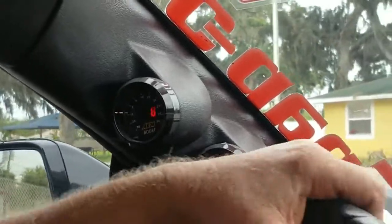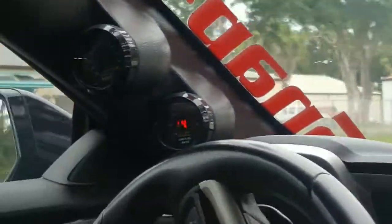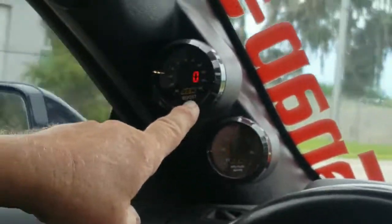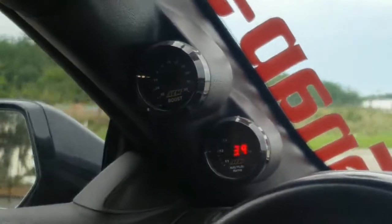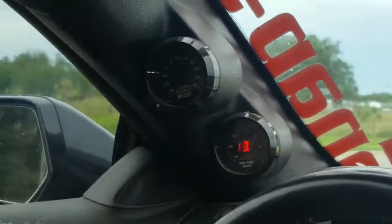This is the reason why you need an alternate or a secondary evacuation suction source. If I step on the gas — we're at light throttle right now — you can see we're at zero. There's zero vacuum because of the valve overlap creating reversion pulses. I let off on the gas and we're decelerating: 24 to 26 inches.